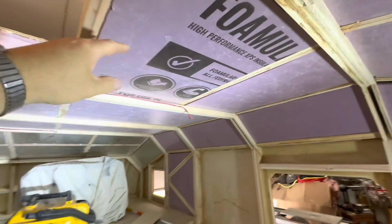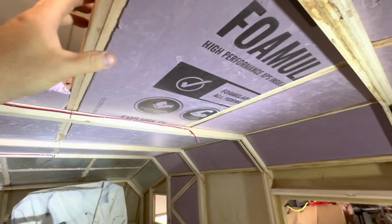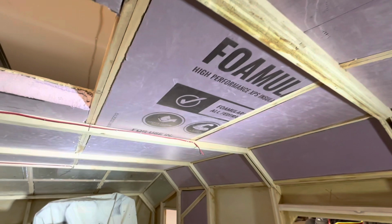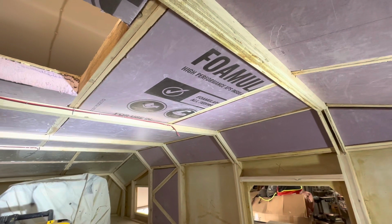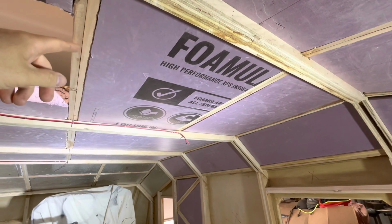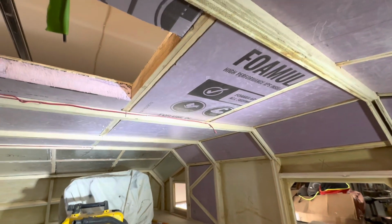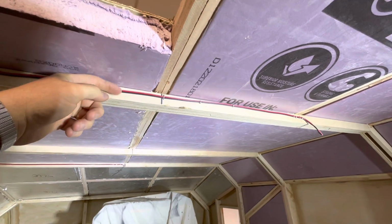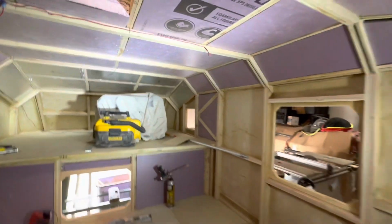construction adhesive. And I'll talk about this in a second, but when I cut out the hole for the vent fan, I tried to pry it off, it wouldn't even come off. But when this stuff bonds to that quarter inch roof material, it makes an extremely strong composite structure. But that's not all for the insulation. So the rated insulation for the 2-inch XPS is an R value of 10. That's what they claim. And then you guys can see right here, I'll talk about the wiring in a second, but you could see there's about a 1.25-inch gap right there, where I already cut the material here.